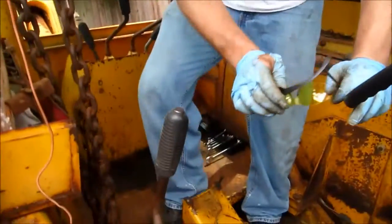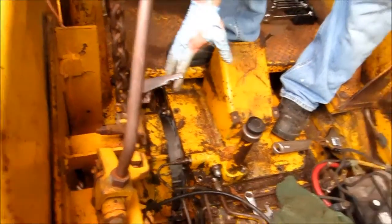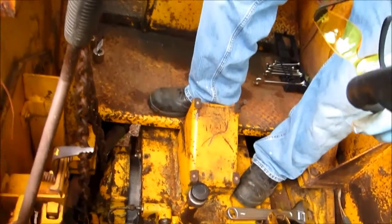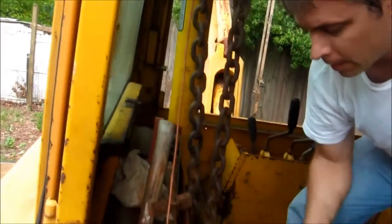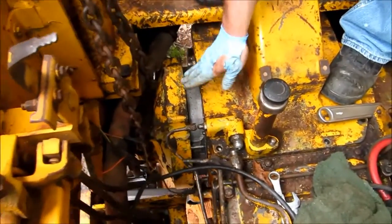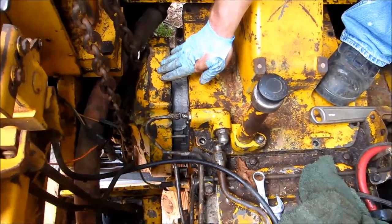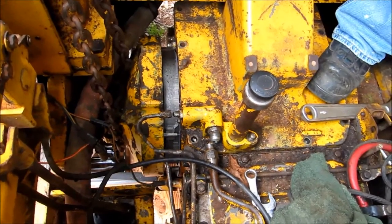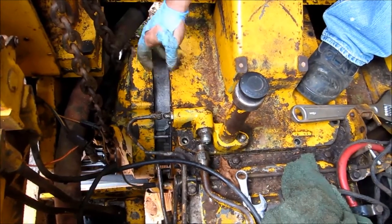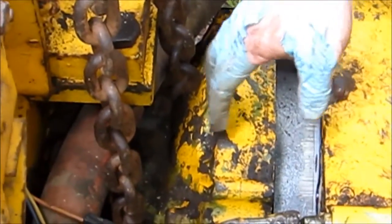I've got the chain around the transaxle and it goes all the way around. Everything's getting close to where it's going to bolt on, but just because of how high the jack is and because I've got to maneuver it around to line it up, I want this chain on here in case anything slips on the jack. I've got a come-along going over the roll cage — it'll hold it in place and gives me more security when I'm trying to slide it onto the pinion gear. The pinion gear coming out of this differential is going inside the pinion gears inside the transaxle. A hydraulic line was in the way pulling it back, so I pulled the bolts out, and now I'll be able to slip them back on and bolt it in.